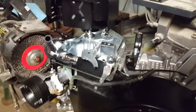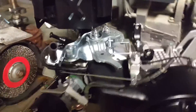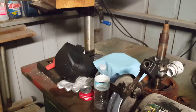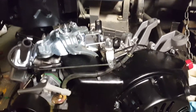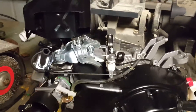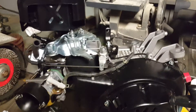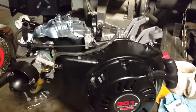The reason I haven't hopped this up yet is because it only has two hours on this engine. I'm going to put the original air filter back on this until I run it for about the first 20 hours of use — that's the run-in, an additional part of break-in. I've already done the two-hour break-in and I drained the oil out and put fresh conventional oil in it so I can continue breaking it in as stock.